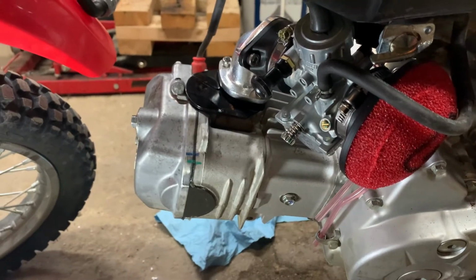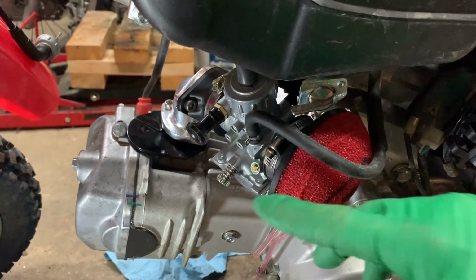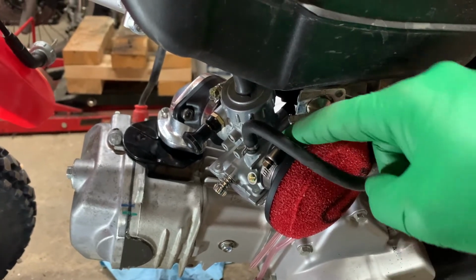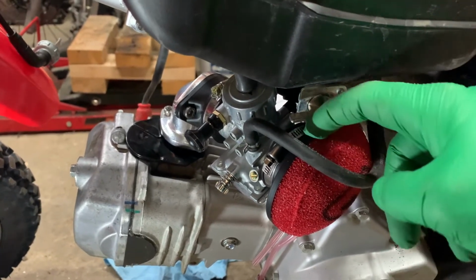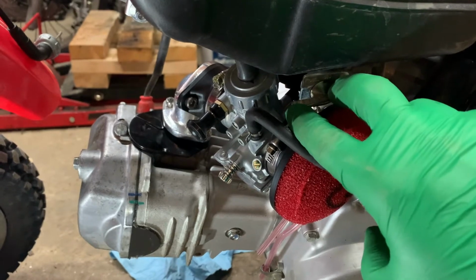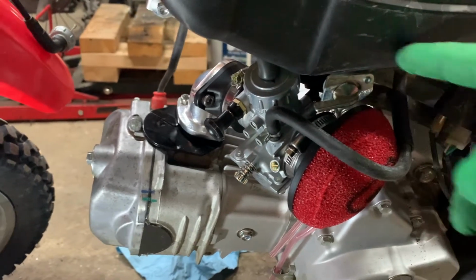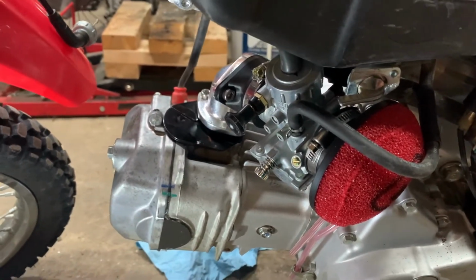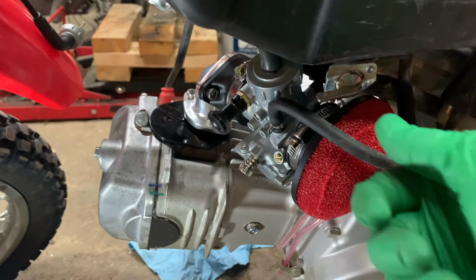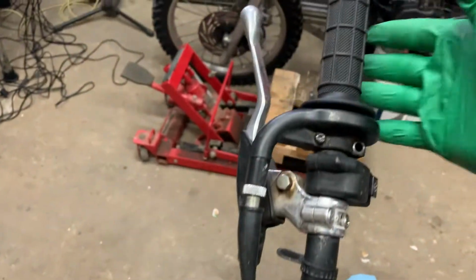It's a good idea to look on the internet at forums for this stuff, because I did end up looking after, unfortunately, and guys are having a lot of problems with these levers. When they're in the on position, it's bumping on this filter, and it's actually falling off. So like I said, you'd have to either run it in reserve all the time, or you run it partially on, but I'd rather run full on. So when I talk to my buddy that owns the bike, I'll see if I can just cut this off and then be done with it, and then it'll be no problem just to get a set of pliers in there and turn it.